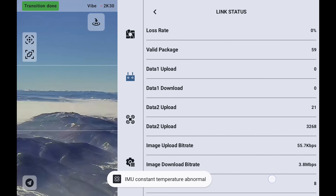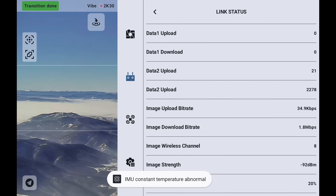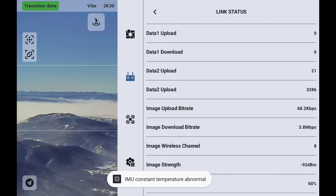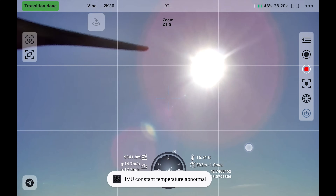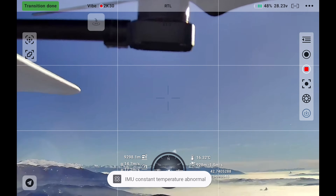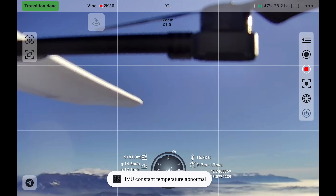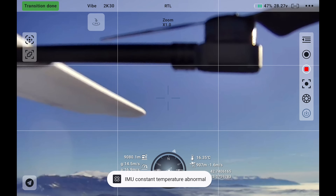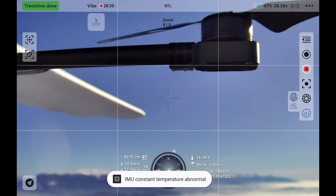Back to the present: telemetry was updating and control was working well. It got me wondering whether being so far from the radio and so close to that TV tower and its very powerful transmitters might have affected the system and shortened this flight. CE do claim that in their range tests over the sea at 200 meter altitude, they were able to get out to 43 kilometers with the stock antennas. I would not have believed this before this flight — now it might just be possible, though replicating that result in this environment is another matter. So next time I will change location, move a bit further up the hill, and try a different direction that does not take me over a TV tower and a large city.